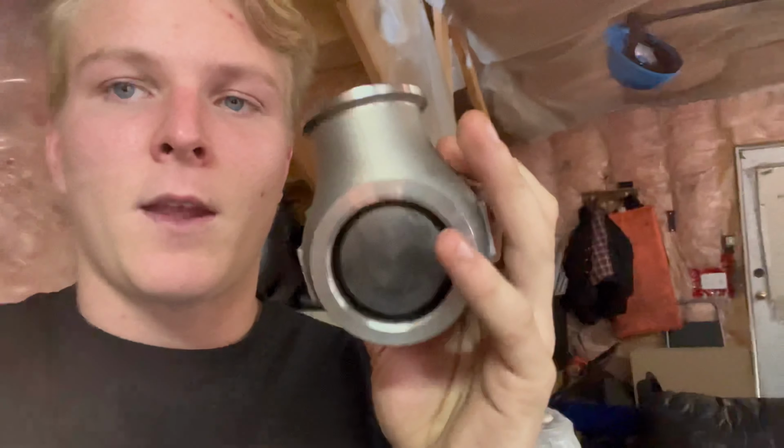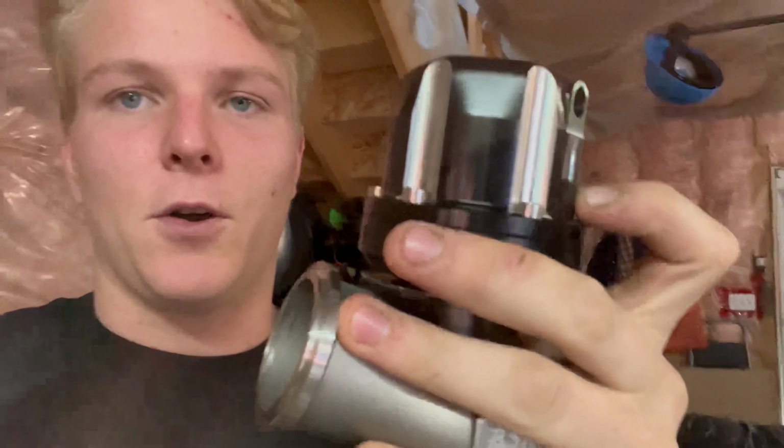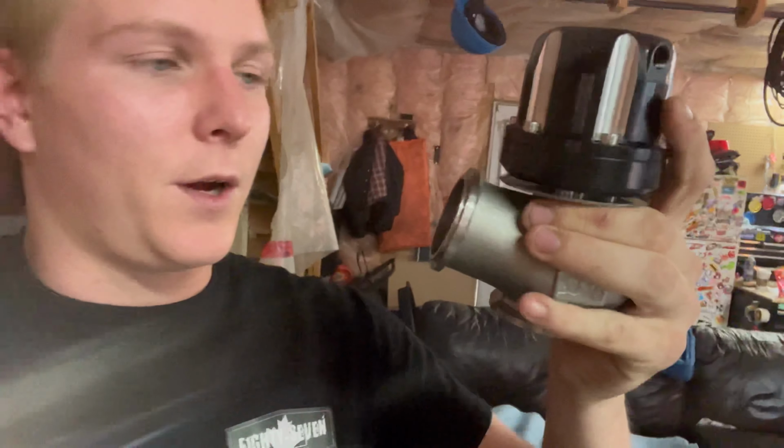Essentially you have a piston in the bottom that goes to your little ring seal, and there's a piston in the top that has an O-ring around it. So there's no diaphragm to damage. Really, there's just an O-ring that would eventually wear out, which is replaceable. I figured this design of a wastegate was quite a bit better. We use them on all the high horsepower cars at my work. We're making like 2000 plus horsepower, so these little guys seem to do quite good on that.